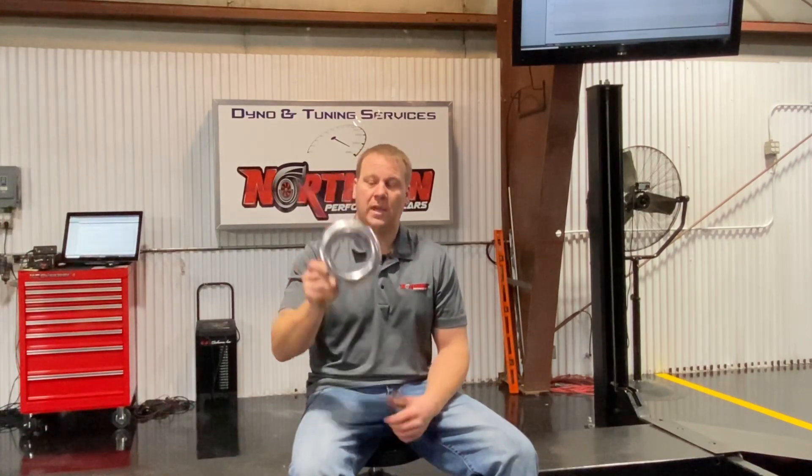We were a little bit tied up at the shop. Most of you guys know that we bought a new shop that's like four times the size of our old one, so we've been really overwhelmed with the amount of time and effort we've been putting into this. But to cut to the chase — on the 408, we ended up throwing a velocity stack on it, got rid of the K&N air filter, and we picked up a little eight wheel horsepower, which clipped us over the 550 range. It made 555 to the wheels with the velocity stack.